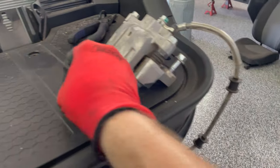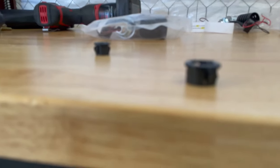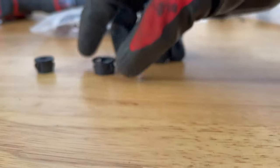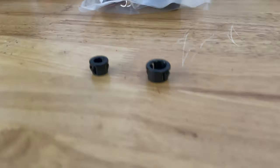These grommets are actually one size bigger than I really needed. So I drilled the appropriate size hole, and now all I'm gonna do is cut these grommets. You can cut the body of them, and then basically treat them like a C-clamp. Then I'll just smash them down a size smaller, so that I can keep the grommet protection, but leave the holes as small as possible. I just don't want any bigger holes than needed in the safety cage. I'm gonna show you how I do this.